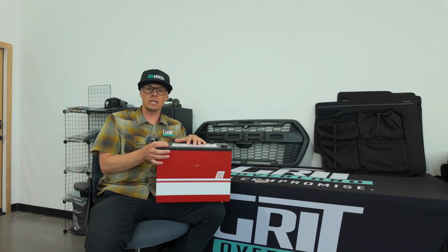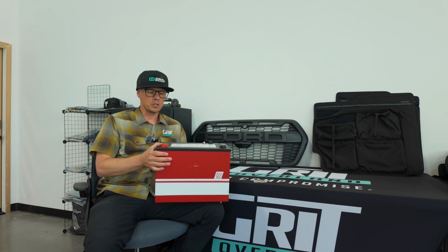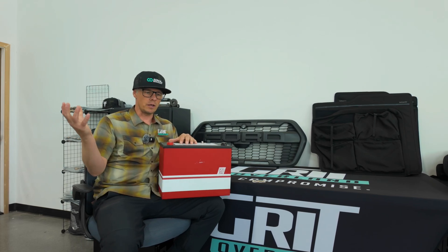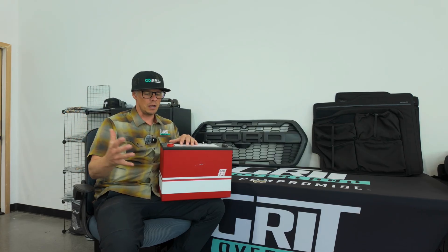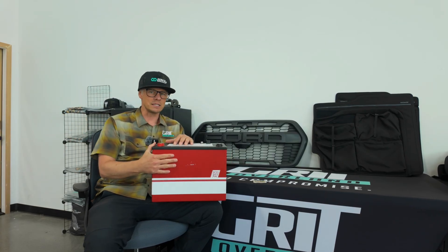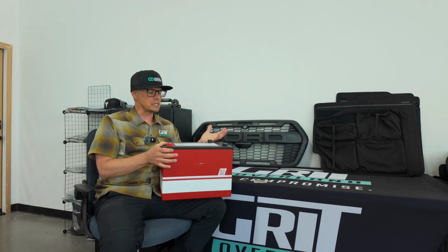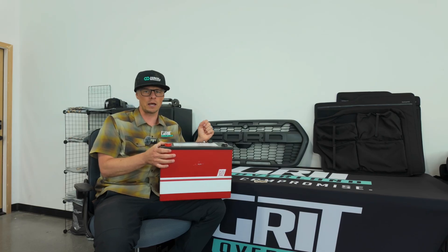This is the beauty of the heated battery pack. It will pull energy from the system to heat itself up. Instead of just counting on the ambient environment from turning on my Timberline heater, it is actually heating from inside the pack and gets up to temp to receive a charge much quicker. So you get a system that is ready to be fully functional in a very short period of time, instead of having to wait on that ambient temperature heating.